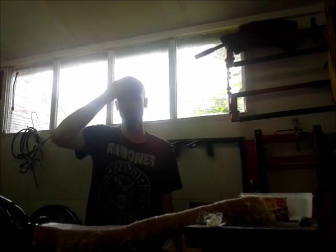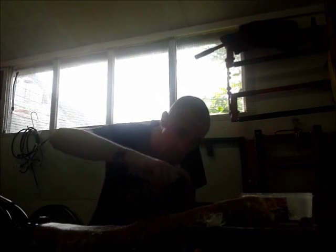That's it. Pretty much out of my supply of glass mat and resin, so that's pretty thick now. Even on the bits where it tapers off an overhang, it's a couple of mil thick. Along the centre and just over the frame rails, that's pretty thick and beefy. So fingers crossed this will be strong enough to do the job, and strong enough to survive coming off when it's forcibly removed. But yeah, there we go.